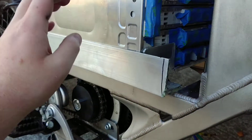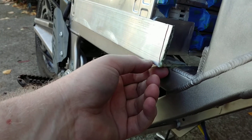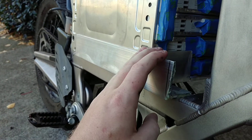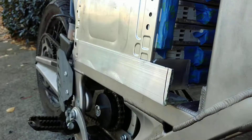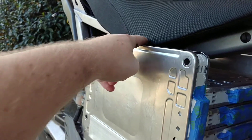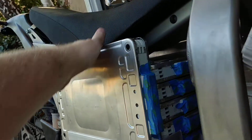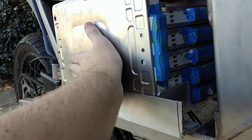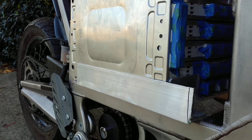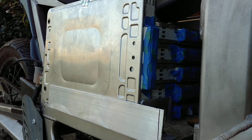Either way, what I was able to do is build a battery cage, and you can see it's a little bit bigger than the stock battery cage, but not by much — maybe like two or three centimeters. The way I did that is I used some aluminum angle bracket I picked up from Lowe's hardware and just cut it up with my angle grinder. That gave me a little bit of area to move out of the frame. You can see it does kind of ride on the outside of the seat, but I don't think it's going to be too much of a problem while riding. I do plan on running a corrugated plastic sheet on the outside to give myself a little bit of insulation and weatherproofing.